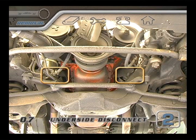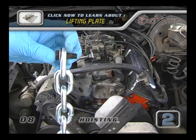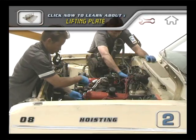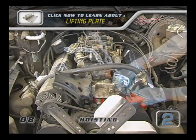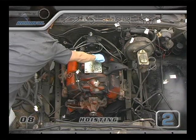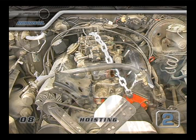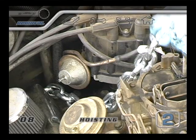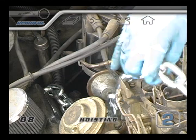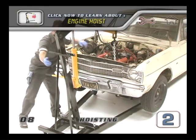When the motor mount bolts are out, the engine is basically just sitting there ready to be picked up — it's connected to the frame at the two motor mount points, and the back end is supported by the transmission mount on the frame crossmember. Next, you need to install the lifting chain or plate. In either case, you have to use grade 8 bolts. If you're using a chain, we suggest one that is rated to hold at least 1,500 pounds. Connect it diagonally from one bolt hole in the back of the head to the same bolt hole in the front of the head. If you're using a lift plate, make sure all of the bolts thread in at least a half inch each. For this engine, we used a chain, and once it was on and the bolts were tight, we pulled up on it to make sure it wasn't interfering with anything. Distributors are usually in the way, but it's okay to loosen them up to clear the lifting chain interference. Double check the ground below the car, make sure it's clear of any tools or rocks, and roll your engine hoist in and hook it up to your chain or plate.